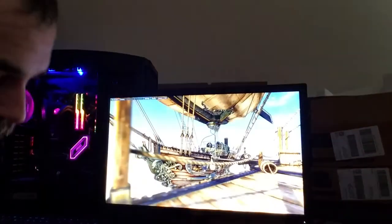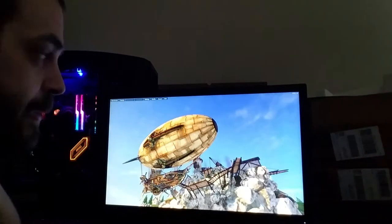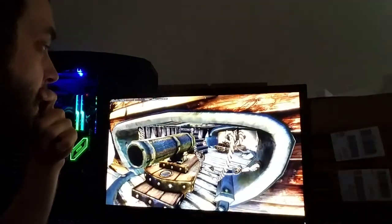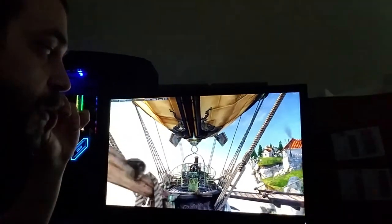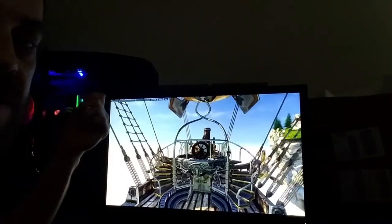So I did run Cinebench at 4.1 gigahertz, and I got like an 890, 895. I almost cracked the 900 score. I was so close to cracking 900 on multi-core. But it was running stable at 4.1 gigahertz in Cinebench and stuff like that. And then I tried to tinker with the graphic settings a little bit, and it pretty much would not work whatsoever. So 4.1 gigahertz is obtainable on a cheap little cooler as long as you're not messing with the graphics.